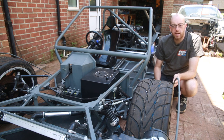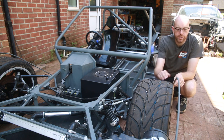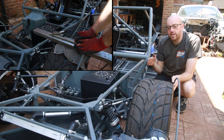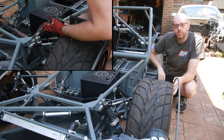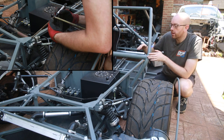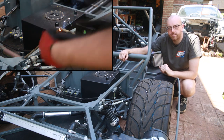The first part we're going to add is some lateral stability onto this outside edge. It moves around quite a bit at the moment because it's just connected at each end. So we're going to go from the very apex here down onto the main part of the chassis. Doing that will form the inside edge of our inner arch, going from the lights back towards this part of the chassis. The roll cage is going to come down from here, forming a big well in the middle — exactly where all the rainwater has been collecting — but it'll be a lot easier to prevent that with more structure in.